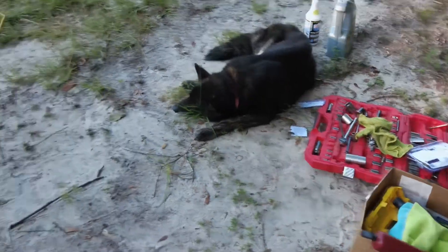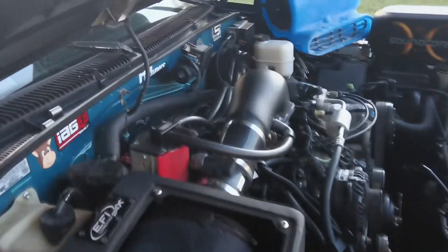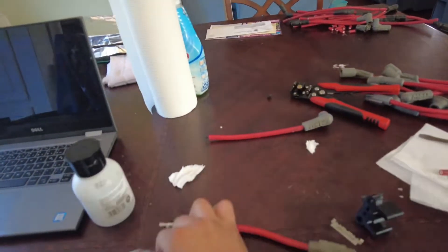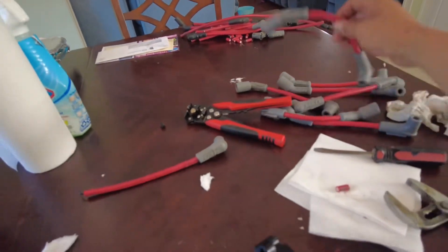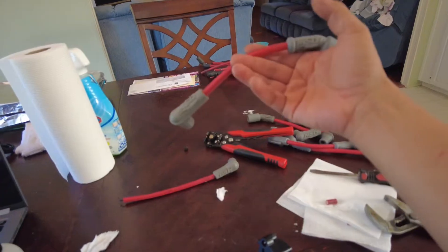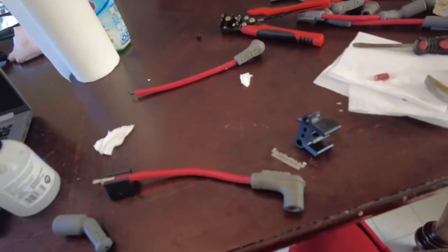Cap's in. I think I'm gonna put everything up — put the shroud on, put the oil back in, put a new filter — and tomorrow morning I'm gonna do the wiring. Right here I'm just installing the boots on my spark plugs. I got the MSD kit. Basically I'm just shortening them up — there's all of them, there's the old ones. These are custom lengths in a way. I'm working on the plug wires.